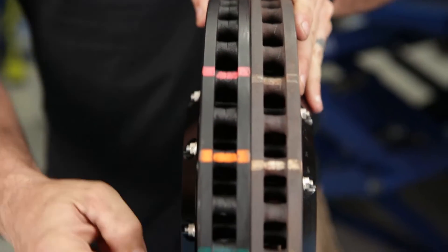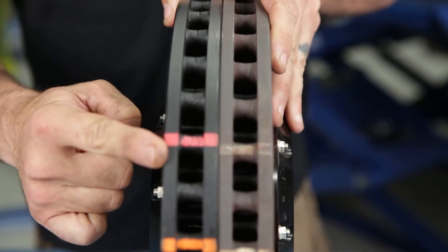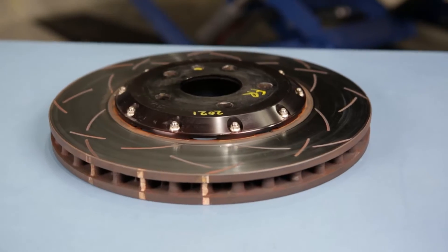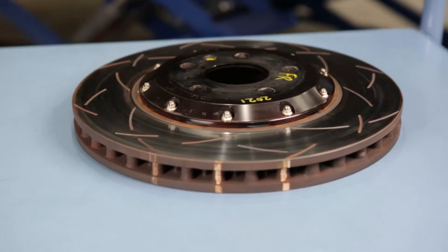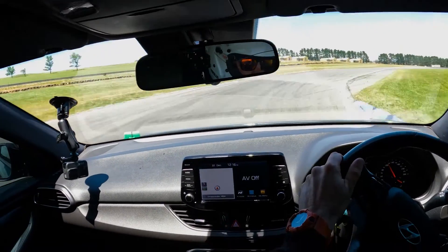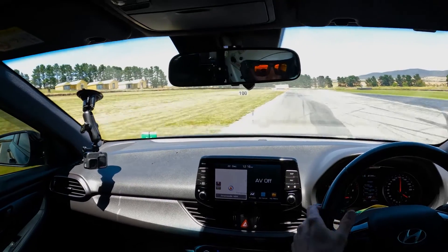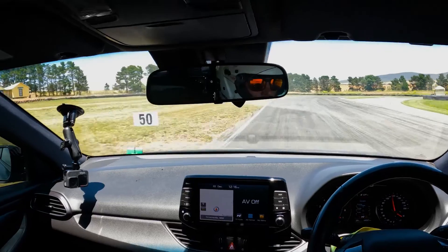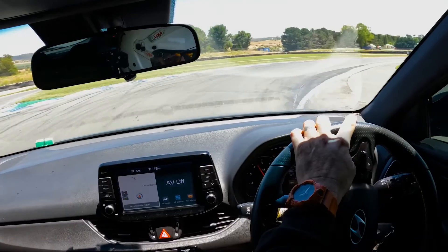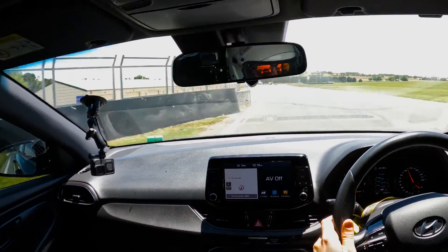The green paint coming off means everything is fine. If the orange comes off, you need to start looking at your driving style and pad selection. If the red paint is gone, you're in trouble and your entire braking system may require an upgrade. If you're exceeding these limits, you should reconsider your pad grades, calipers, rotor size, and driving technique. Take note of the time and distance the brakes are applied into a corner and compare them to other drivers — one or two seconds of additional braking coming into a corner can make a substantial difference in rotor temperature and product service life.